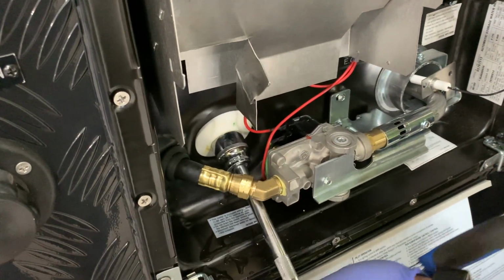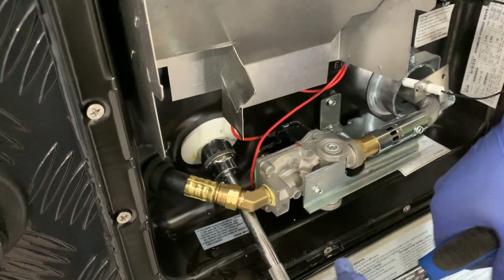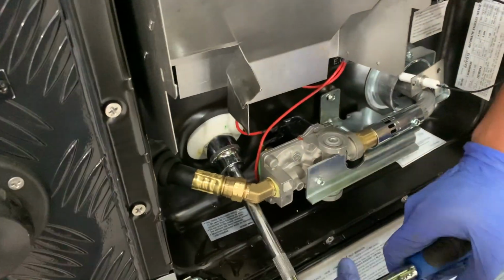Make sure all of the valves are closed, that blow-by valve that I mentioned earlier, make sure that that is closed up too, otherwise water will shoot out of that when you have water in it later on. So there you have it, the winterization of our Black Series HQ models. Hopefully we're able to get you all the information you may need, and that way you're able to successfully winterize your own unit in the future.